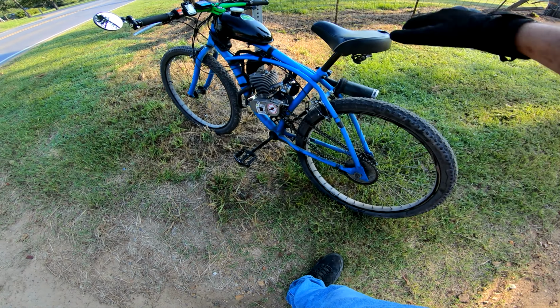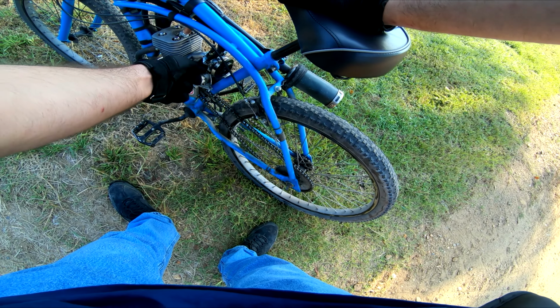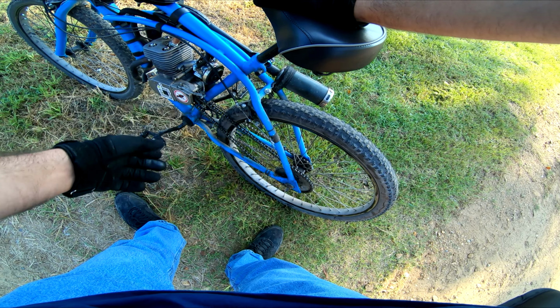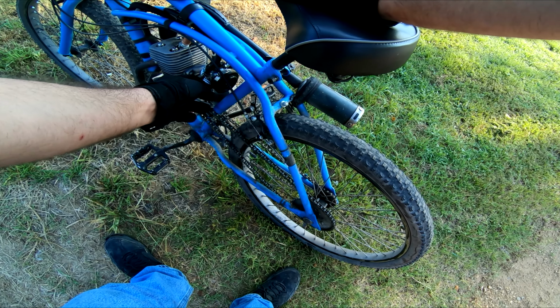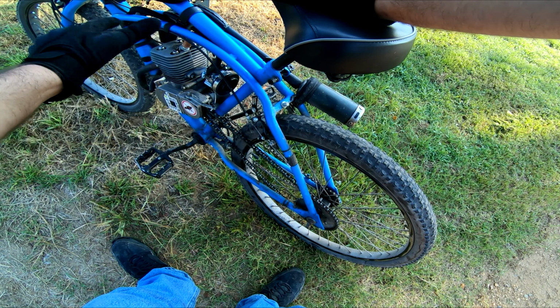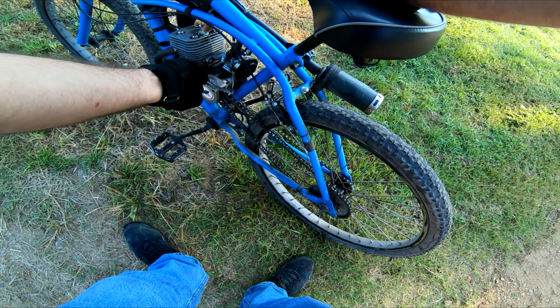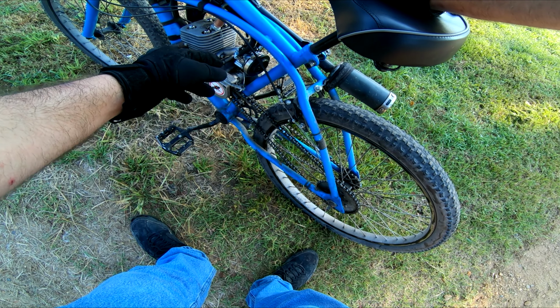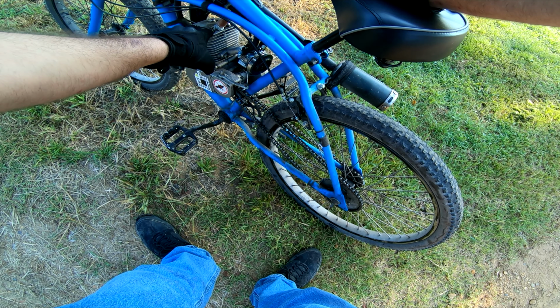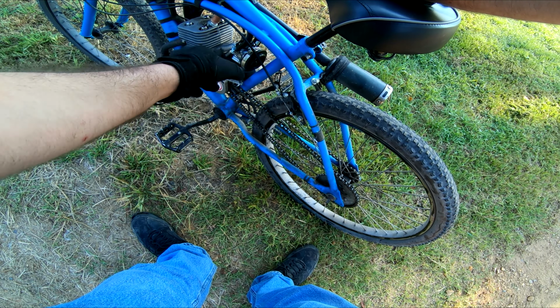All right, we're here with the Bassett Blaster. Shout out to one of our YouTube viewers, The Authority, for hooking us up with an HP carburetor for testing. I've been swapping the jets out on it. What's happening is it pulls just fine, but at wide open throttle, once the motor starts to line out, it just completely dumps and starts four-stroke and breaks up like crazy. So I've gone down to a 72 jet up from the YD100 stock 77. Now I think this came with a 72, but I never tested it with the stock jet.